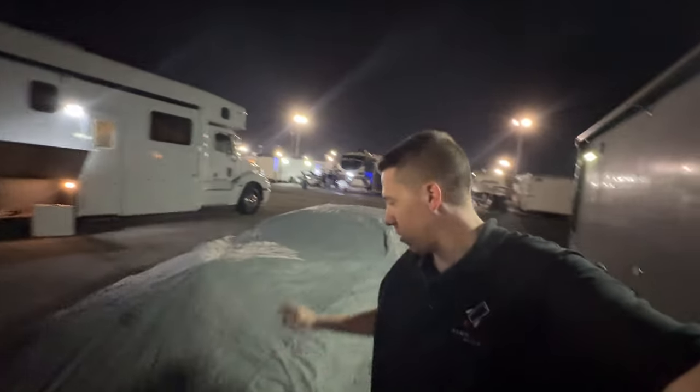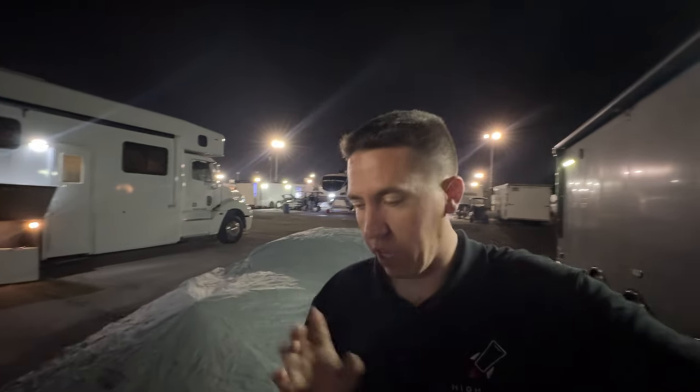All right, everyone, so salty's put away for the night. I think we actually figured it out. Shout out to Tim at Borowski for helping me figure out all the oil issues. It looks like since this head is drilled for LS3 and LS7, if you don't plug the holes in the head, you can actually get oil that comes up through there if they're drilled all the way through. We looked back at photos from before when I had the head, and it appears that that most likely is the problem. So I will be looking tonight for LS7 intake gaskets and some bolts to plug those holes.